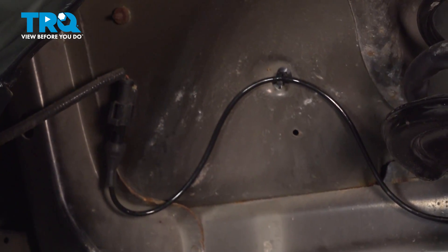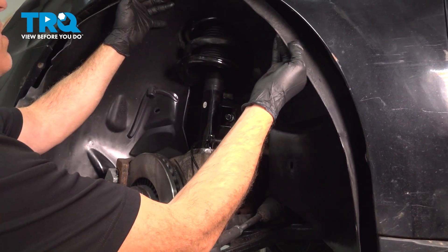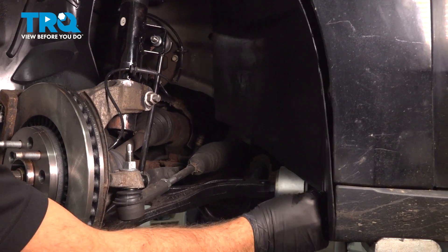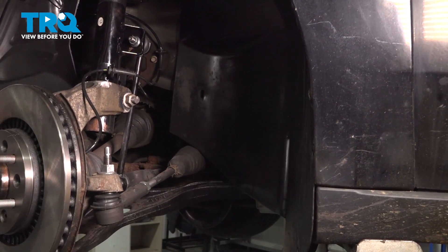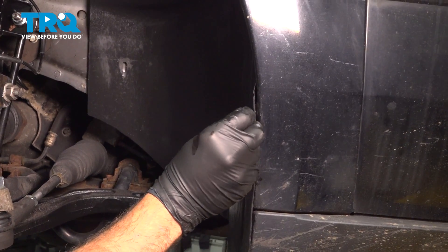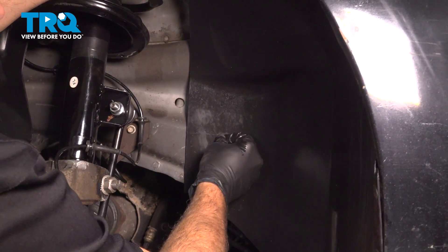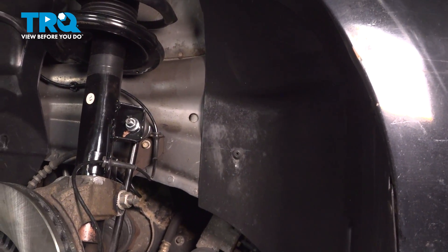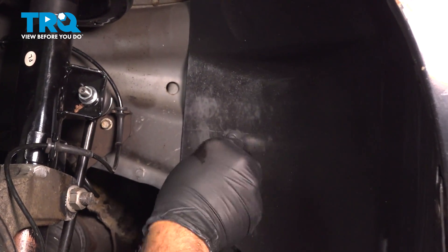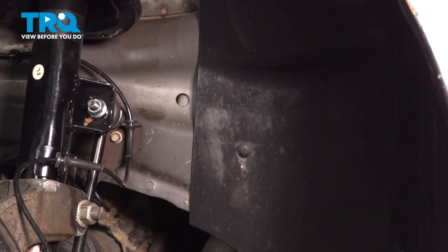Once that's locked in, you're all set. Get the liner up into position and bring the back around. Go ahead and install your two lower pushpins. Insert one of the bases and install the center. Repeat this process for the rest of the plastic button inserts.